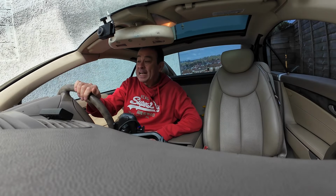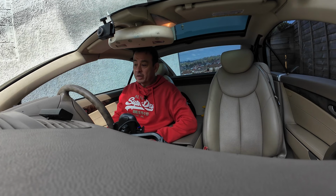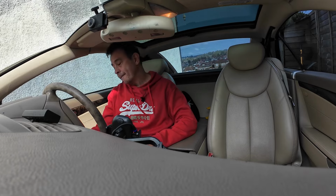So if you're running a diagnostic, just a little point to add is that it can actually drain the battery, because you've got the key just on before you crank the car. So all the computers in the car, the control units, are on. So you may want to start the car. There's no harm in doing that. So I'm going to start this car up and we'll continue the diagnostic.